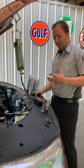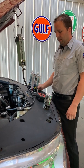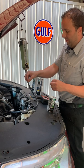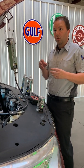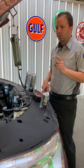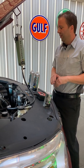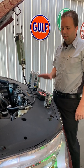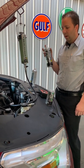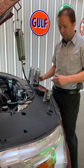This is a time-consuming process — probably a solid hour worth of cleaning will take place here. In our next clip, we're going to show you actual bore scope video from inside the cylinder, and we'll show you the carbon buildup on the back of the valves for this car. This is a 2015 Buick Enclave with a 3.6 liter V6. The car only has 49,000 miles — very low mileage — but I think it'll surprise you how much carbon buildup is already on the back of those valves, and why we're pushing for a GDI maintenance every 15 to 30,000 miles.